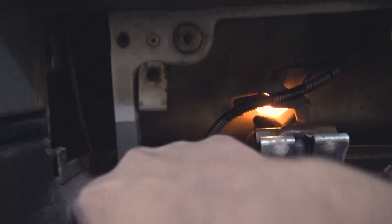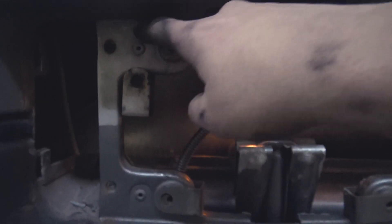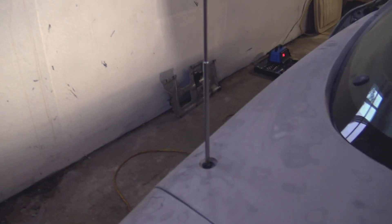In order to get to the tail lights you have to take the reverse lights off — there's one here and one here, held on by two 10-millimeter bolts, same thing on that side. I'm taking this off completely and just filling it up to have it all smooth.